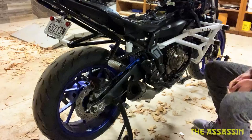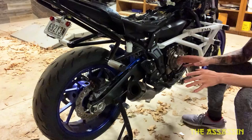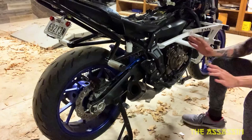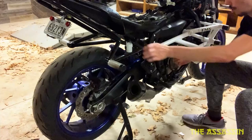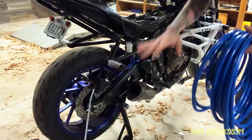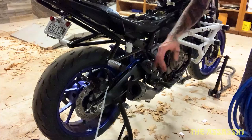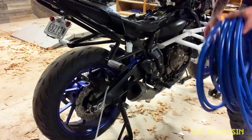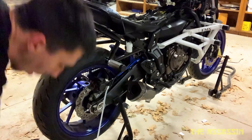Cool, we got it — I'm super stoked. The plan is to fill everything up with brake fluid, front and back. I'll do the back first because there's only one cylinder. Slowly pour in some fluid, suck it through the system, then finish with some pumps and full bleeds. Also — keep the reservoir topped off while you're using your suction tool because if you suck it all the way through you're going to have to restart everything.